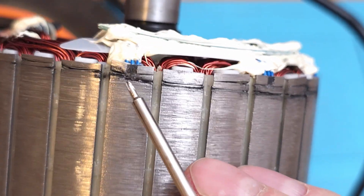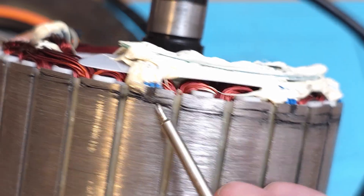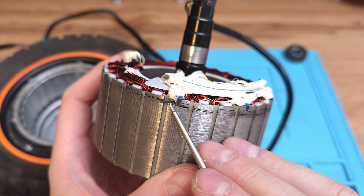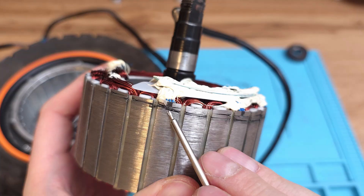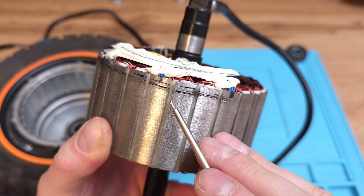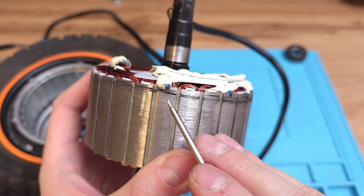The worst part is that this motor has to be replaced, because if some other fin pops out in the near future, then this motor can just stop working - just stuck. And that's why it has to be replaced. Also we've got this damage around the hall sensor. So this is really bad. This is the worst case scenario where the motor has to be replaced.